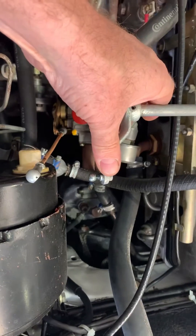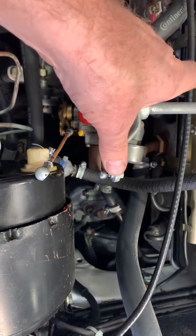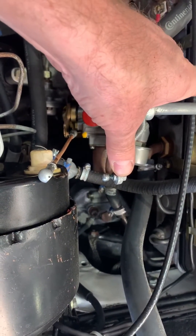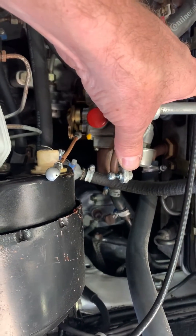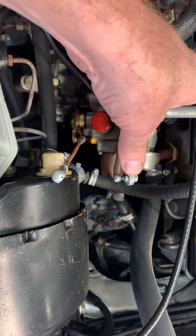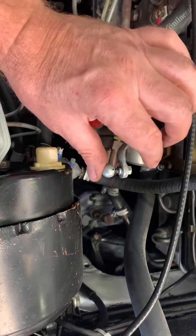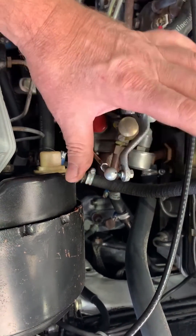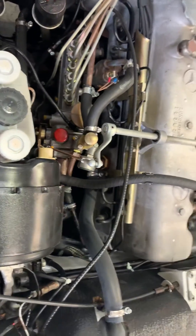If I open this up, there was a brief burst because I've just added fuel and it was a little flooded. But you can see now that it doesn't want to accelerate. But if it did accelerate when I opened the throttle without introducing fuel, that would mean that the engine was running too rich — and by adding air only, you will even out the mixture so that the engine will run better. Just a quick basic check: am I too rich? Am I too lean?